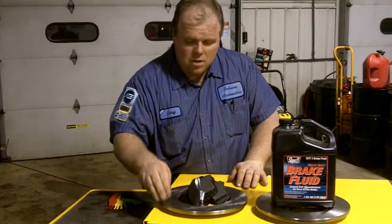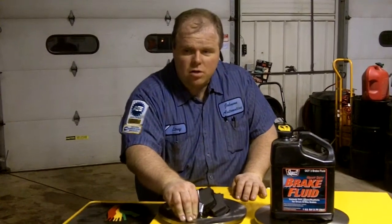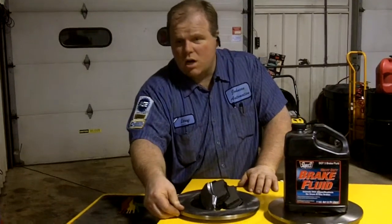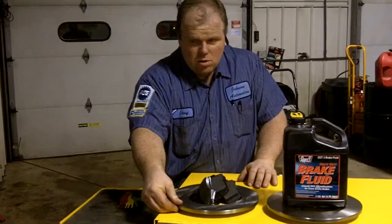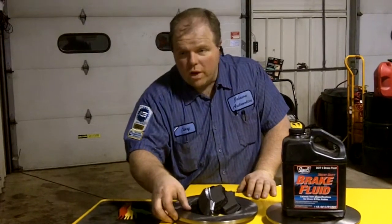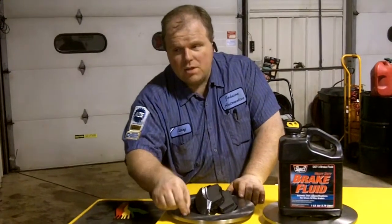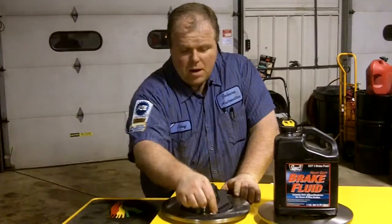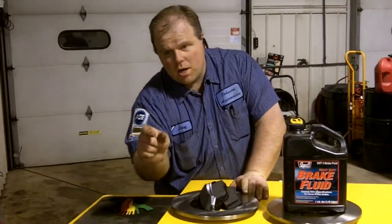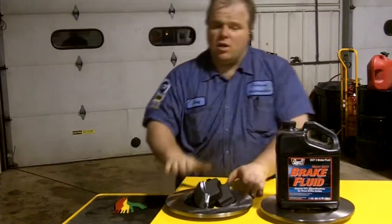Also, brake rotors — nice, shiny, look like metal. I will tell you that brake rotors are not made of the same material they were not even 10 years ago. Although I discourage it, some manufacturers have designed brake rotors so that they may not be turned — they were never intended to be turned. More and more manufacturers are going that way in two ways: one, in the design of the rotor so they're not able to be turned, as too much chatter is caused through the design of the metal and the rotor. Also, you're talking about taking something thicker, making it thinner, and heating it up and expecting it not to warp.